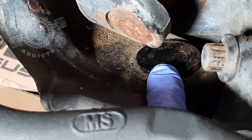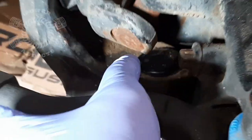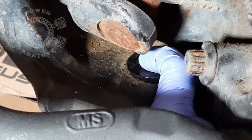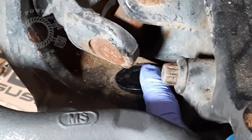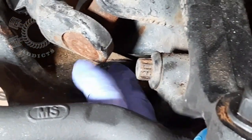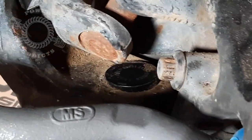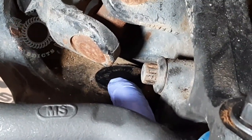Those particular style grease fittings take the needle style grease injector. What you'll do is take the needle, come in from this angle right over the top of your tie rod, and inject the grease into the edge of it. Then in some ball joints you'll have the grease fitting right in the top middle. If you're putting in new ball joints, be super careful about that, because oftentimes putting a new ball joint in the lower end that's a greasable style but has the grease fitting in the middle - this is your axle and U-joint. These ears on the U-joint spin and rotate, so if you've got a fitting right there and you put it in and it's too tall, this will come around and take out that grease fitting, hit it and break it. So pay very close attention to that - sometimes you've got to go to the 90-degree style fitting or the super short style.